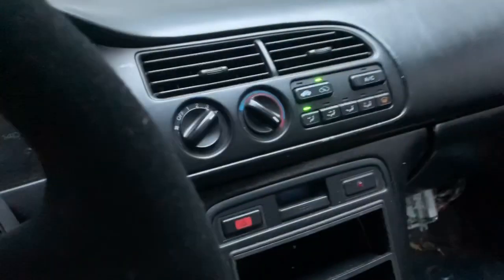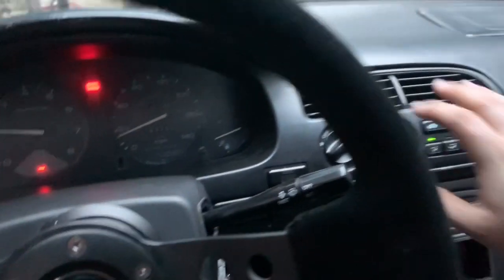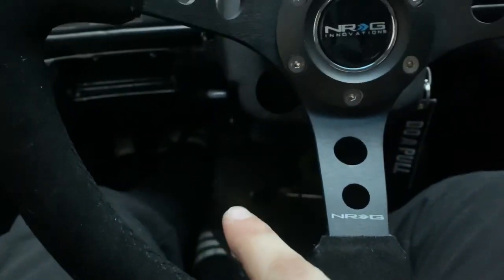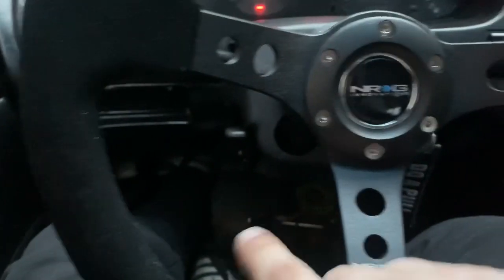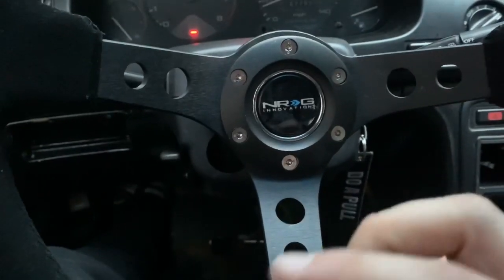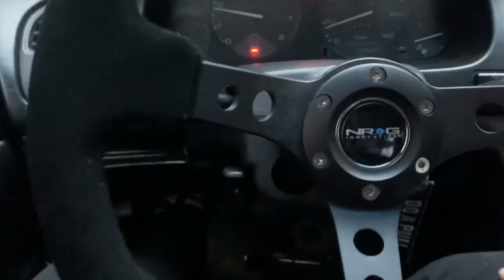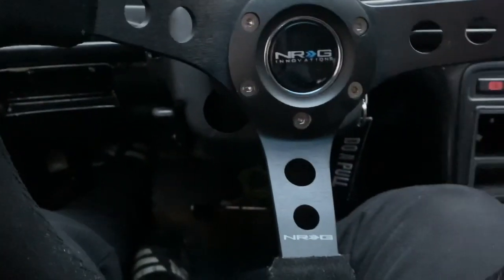All right, boys, so good news. I got heat. Got heat in the car. The blower motor is blowing. It's turning. One of the relays down there at the in-car fuse box is like sticking off. So basically when I turn it off, it just won't turn back on. But long story short, when I tap them, obviously it'll turn back on.